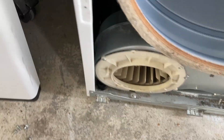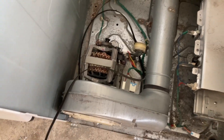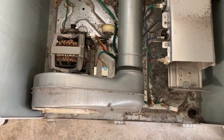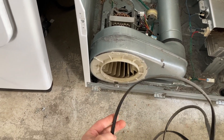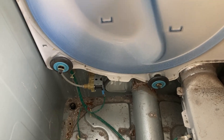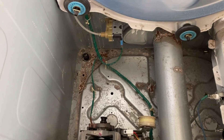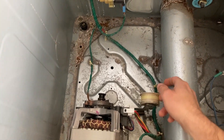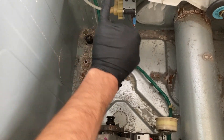You'll lift up — I need to reach inside and work with the drum. The whole assembly should just come away. Lay that aside. From here you'll be able to do your belt work. Go ahead and pull the drum out. You can see inside now, and here is our broken belt.